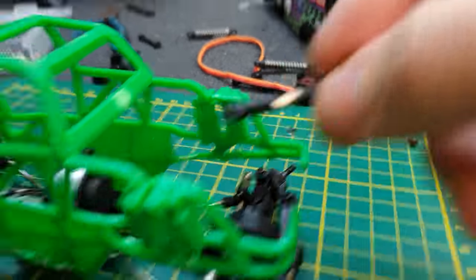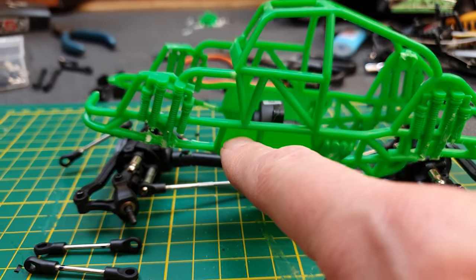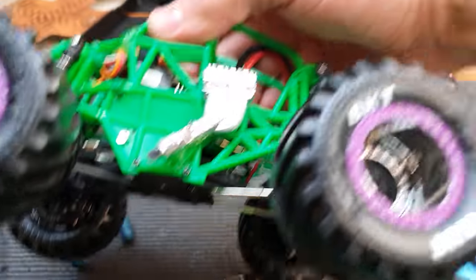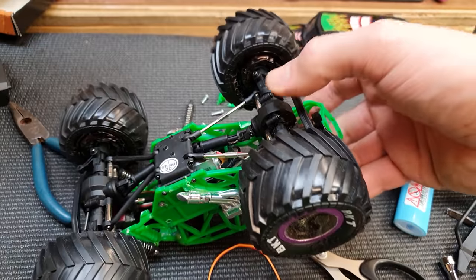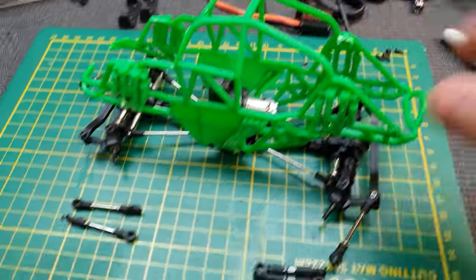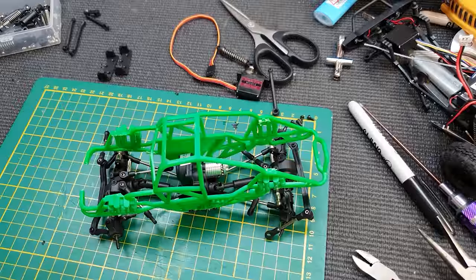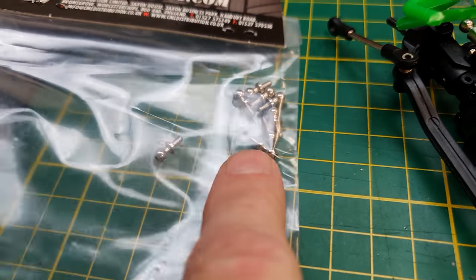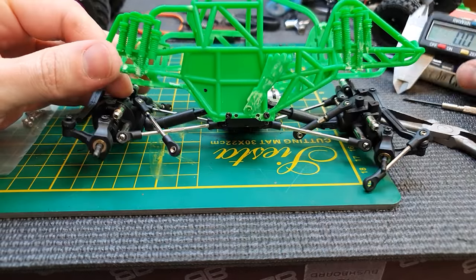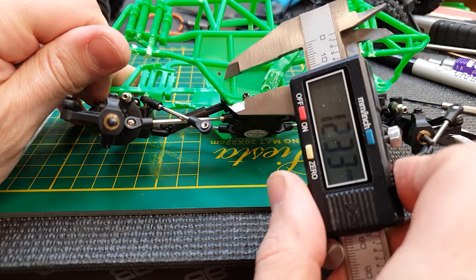Next I've got to see what sort of links we can use as top links. I'm going to use the steering links from the Devastator as top links — they'll hopefully come out and screw into this piece here. On the rear it's a little more difficult. I'm going to use some shorter links and glue a piece of plastic in there. I've marked out where I'm going to drill the hole for the upper four-link bar: 7.3 millimetres to the centre from this tube, and 15.5 millimetres up from the bottom.